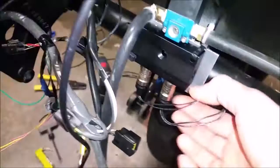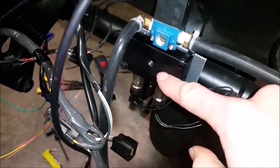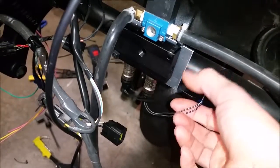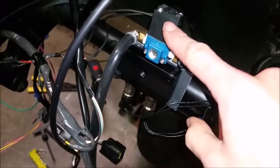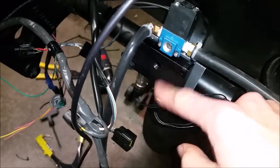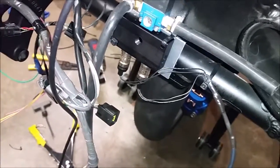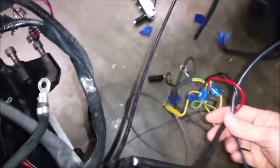Right now they're loose, but I'll end up trying to run around the frame at the front of the motor. One of them connects to this solenoid, which I've mounted — this one controls my blow-off valve, this one will be for the wastegate. This one doesn't come in a kit; it came with my turbo kit. I will run a CO2 line to this and end up going to the wastegate in order to control the PSI.